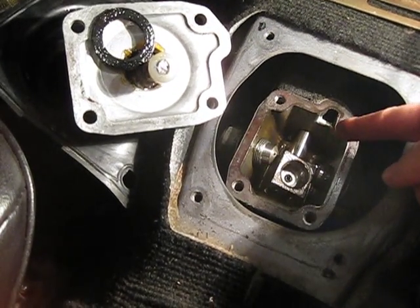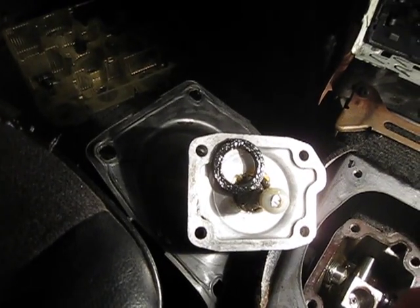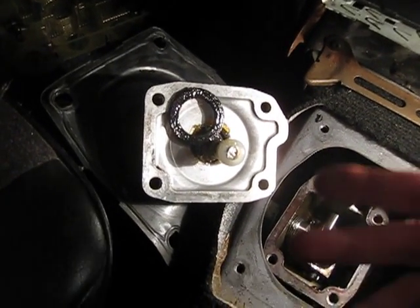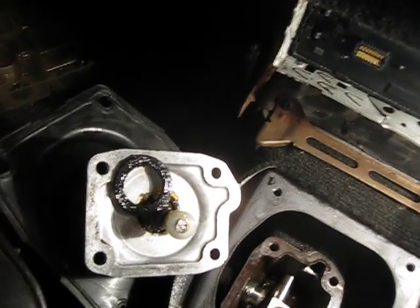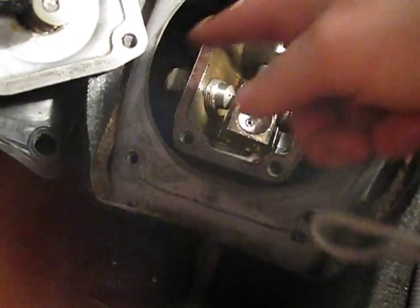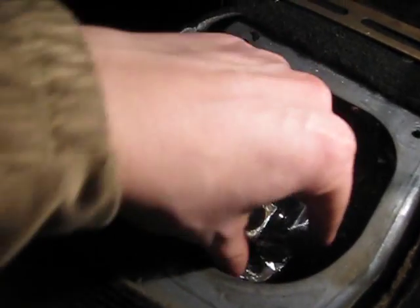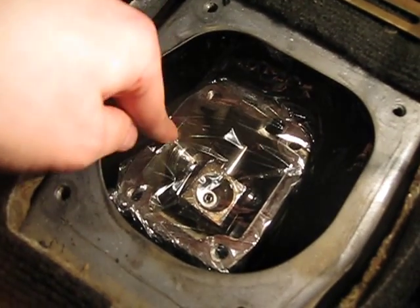You can now see the shaft going to the gearbox — there should be a washer here. I worked on this previously and put some grease here, but I'll replace it with lithium grease. I didn't know at the time that it wasn't the proper way to lubricate a rubber joint. Now we can see the gearbox itself, so we're ready for the next step. I'll put some food wrap over this gasket just to make sure no dirt gets in — it's not perfect but does the job.